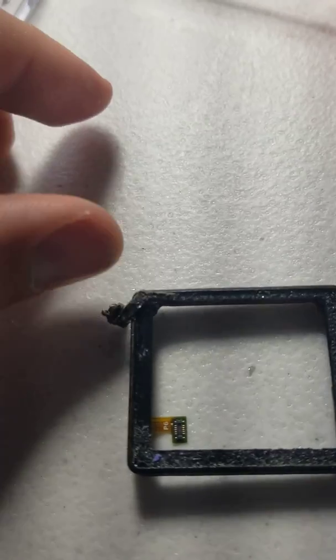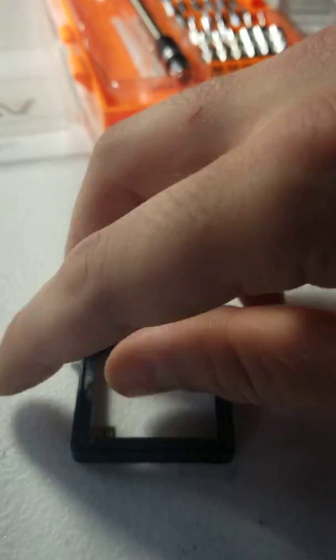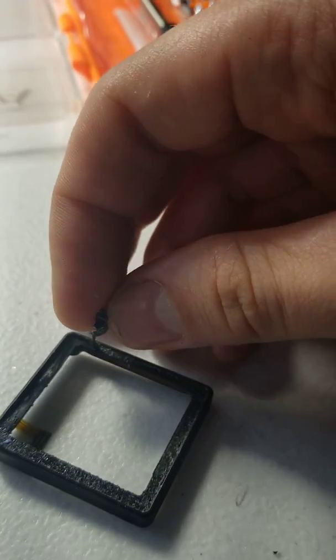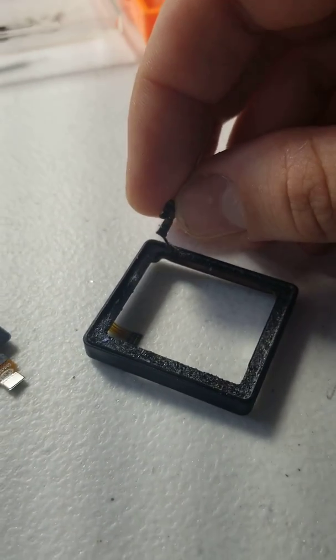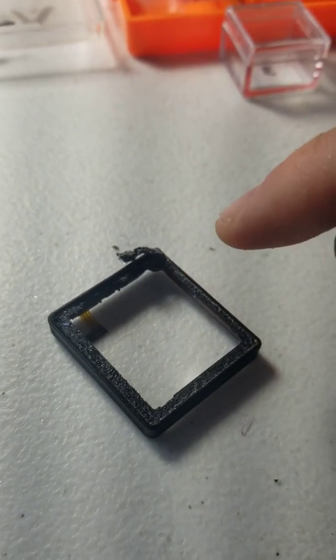Here's where we lucked out — as we started taking out that last bit of glass, the adhesive started coming up. See how the adhesive comes up in a strip like that? If you can do that and get as much of the adhesive off in one piece, you can really clean that surface and make sure that it's ready for the replacement. We're going to see what we can do to stick it down, but I'm going to try to pull this adhesive off in one strip around it as much as I can.